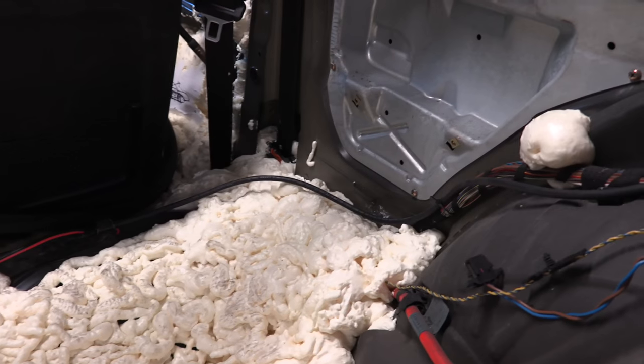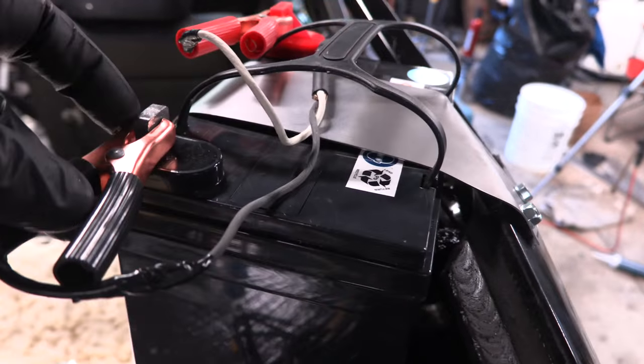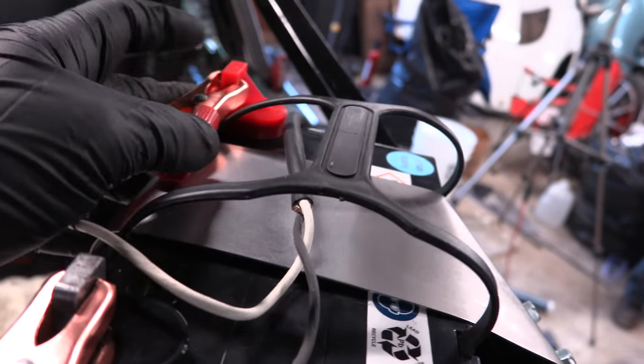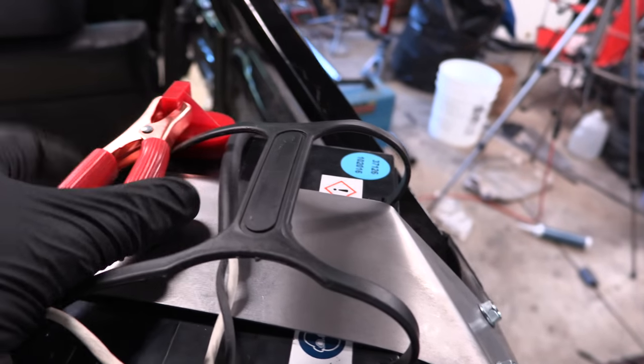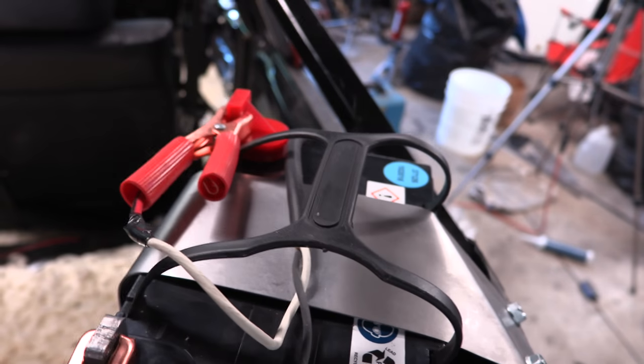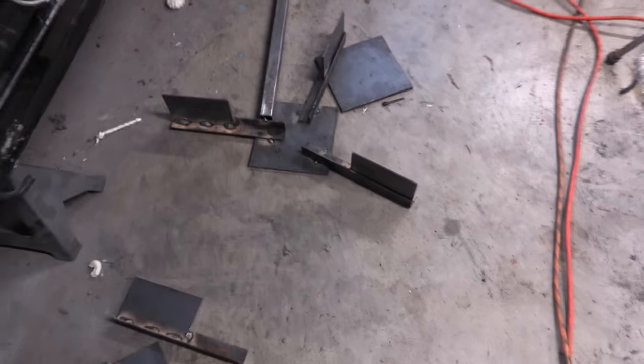All right, our pump is all wired up. We ran a wire over there, along the side, and up to our little auxiliary battery here. You have the negative, which will always be on, and then the positive is on a little piece of plastic. So when we're driving and we wanna turn the pump on, just pull that piece of plastic off and attach this on there, and then the pump is on. Meanwhile, Eric and Jason are over here and they are welding up the paddles for the wheels. Those are gonna bolt onto the side of those, and that's gonna propel us in the water.